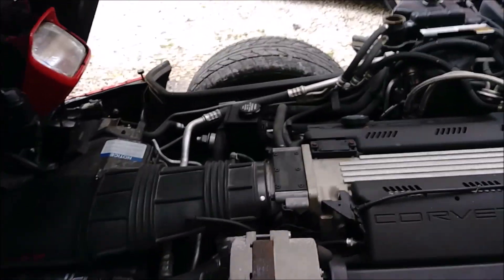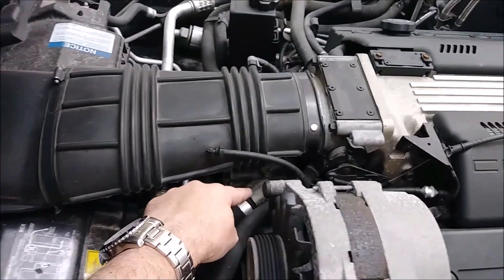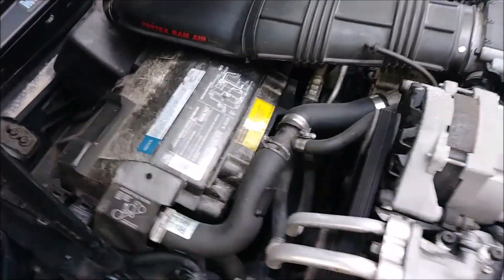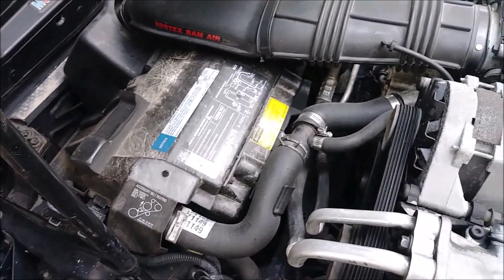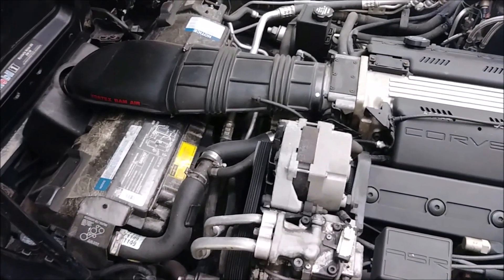I'm not really sure of the direction of flow. I know it cools the heads first on these LT1s, which they call reverse flow. I'm not sure if this is the recently cooled coolant going into the pump and then pumping out the other way, or if it goes in on the other side and the yucky stuff comes out this way into the radiator. I'll have to look into that and draw some arrows. I'm gonna disconnect the hoses and flush the radiator with a garden hose - once it's flushed clear, I'll spray water in from the correct direction to get most of the orange out before running the flush. That's the game plan.